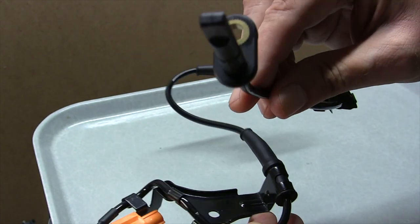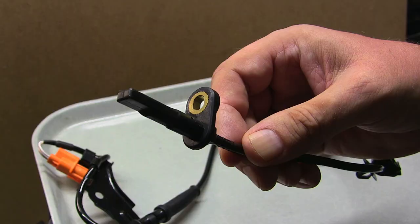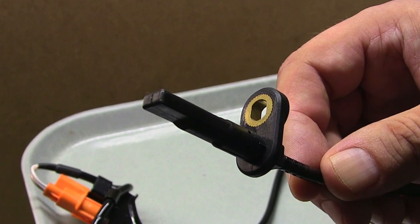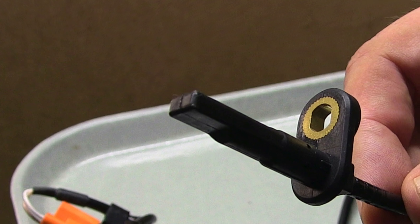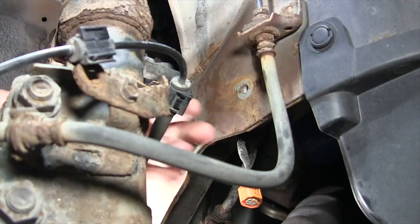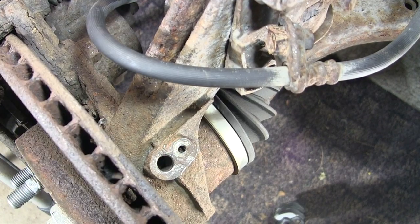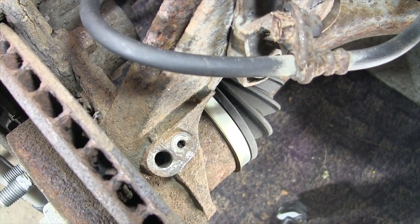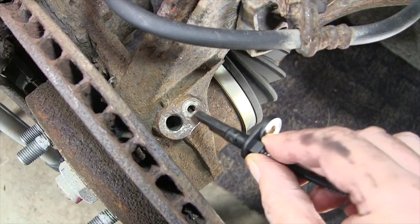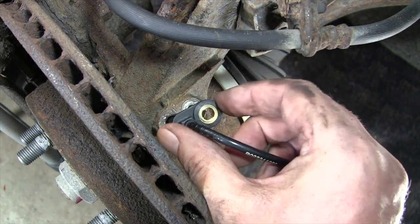At the other end of the cable is the actual sensor — the magnetic pickup that actually goes into the wheel hub. It sends the speed signal to both the anti-lock brakes and the vehicle stability assist. With the bolts removed, I could now pull the plastic cable anchors out. This old cable certainly had a rough life. I did struggle a bit to get the old sensor out, but I could now see the hole that goes down into the wheel hub. The new sensor fits snugly and the bracket lines up with the mounting hole.